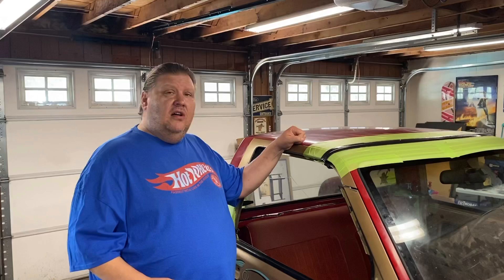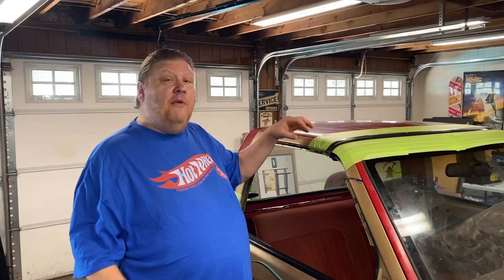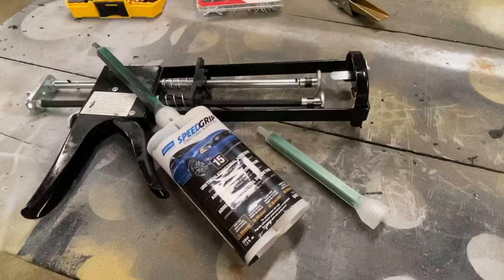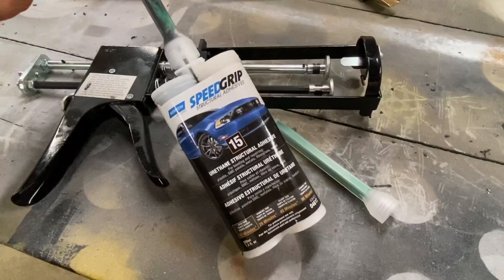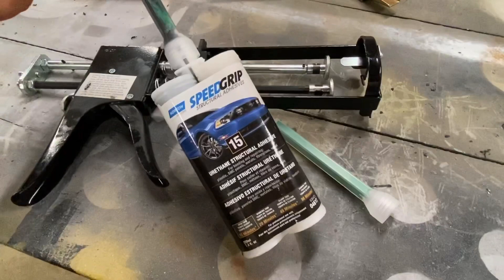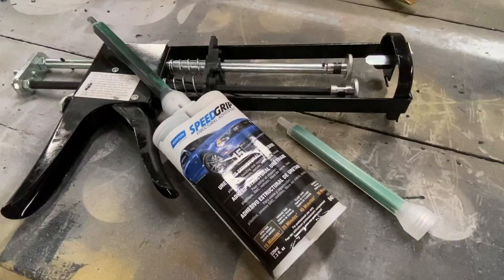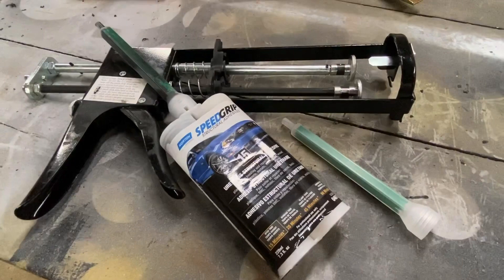Now that we've got our latches installed, we did a dry fit of the kit — just put the kit on and latched it down to check our fitment. The fitment looks pretty good. Now it's time to epoxy. Before we take it off and actually epoxy, we put masking tape on the front and back of each side of the kit — that way if any epoxy squeezes out when you clamp it down, it doesn't get on your paint. That stuff is hard to get off metal; you don't want it running down your windshield. For epoxy I like to use Speed Grip by Norton — it's a structural adhesive, number 15. It dries in 15 minutes and in 24 hours it's hard as a rock. You could also use 3M Panel Bond or a few other products, but this is what I rely on.